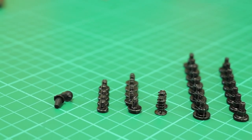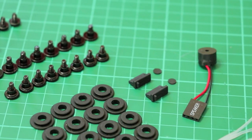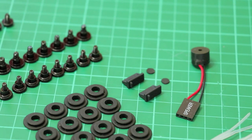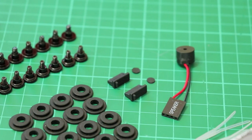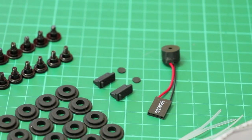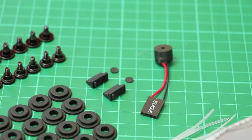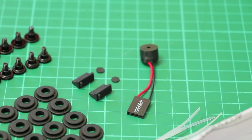Then there's a couple of audio jack plugs, and then heading to the other side, there's also a couple of USB plugs. I presume this is for the home theater style setup, so that it'll be stuck in a cupboard or something for months on end gathering dust. There's also a motherboard speaker included. Now if you don't know much about motherboard speakers, to put it lightly, they can be extremely handy when diagnosing problems with your system. Easy debug LEDs can only provide so much information.